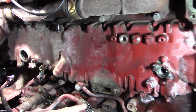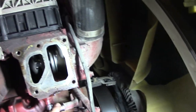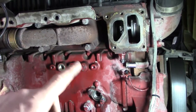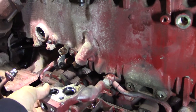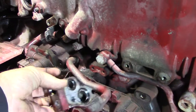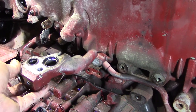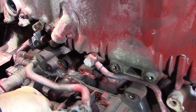This has much more plumbing for the coolant than the MP7s. As you can see, this coolant pipe here is a real tough one to get to if you have all the piping in the way, so I am changing that rubber hose. For the turbo, the return line is different — it actually goes into the block right here and bolts up to the bottom of the turbo. It's kind of tricky. You've got to take the bolts out and actually leave them there until you remove the turbo. The bolts will not come out because you'll hit the top of the EGR core. So that was a little different.